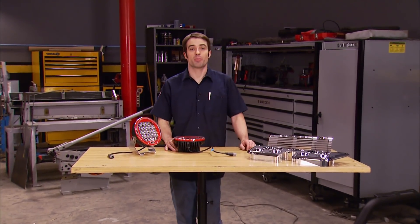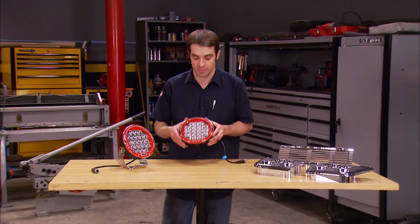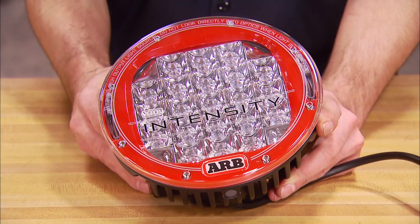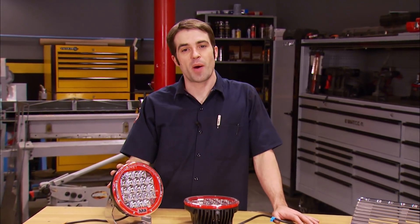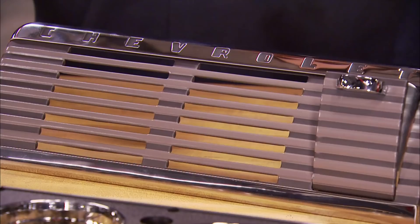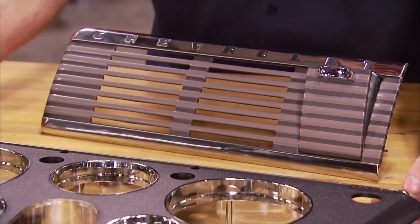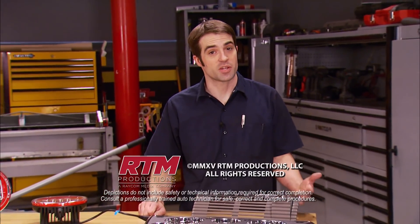If you're looking to add some seriously bright lights to the front end of your pickup truck or SUV, check out these ARB Intensity Next Generation Driving Lights. The high-pressure cast aluminum housing has been powder-coated and acts like a heat sink. It's got an unbreakable polycarbonate lens, and the 32 LEDs put out a daylight-type color temperature, producing almost 7,000 lumens while drawing just over 6 amps. The lights come with an adjustable stainless steel mounting base and are available in a 10-degree spotlight or 20-degree floodlight. If you're restoring an older Chevy pickup, check out the interior pieces from Brothers Truck Parts — including a stainless steel-trimmed speaker cover with ashtray for '47 to '53 Chevy or GMC trucks, and a reproduction instrument bezel for '69 to '72 pickups with a textured black and chrome finish. Thanks for watching Truck Tech — see you next time.